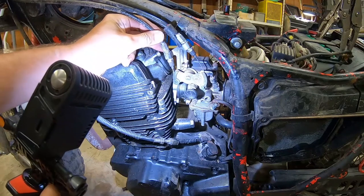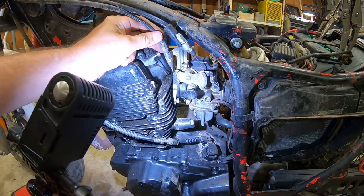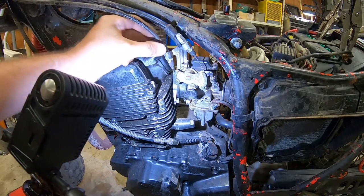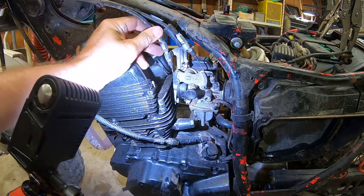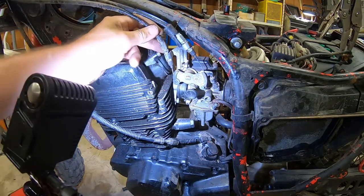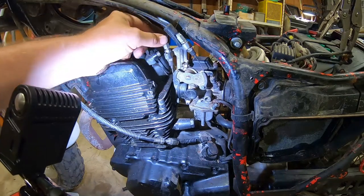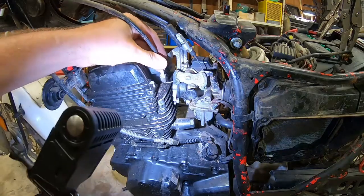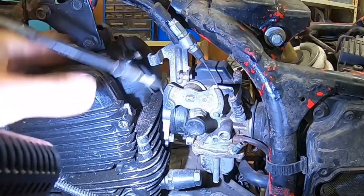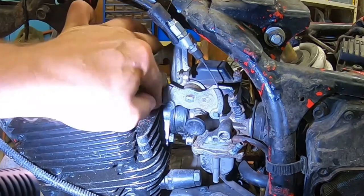There's two nuts. So once you got your throttle position set, like the slack out of the grip, then you would set one of these, and then you'd tighten it together with the other one, and it's just been riding around in there finger tight. I don't know how that never fell off, tell you the truth, but that would have been a pain. Anyway, now we can slide the cable down under, and the barrel then will slide sideways. It's hard to do one-handed, but I'm gonna try.